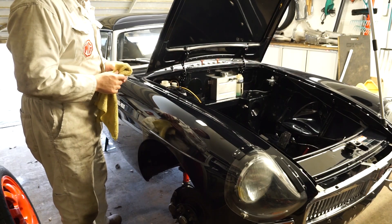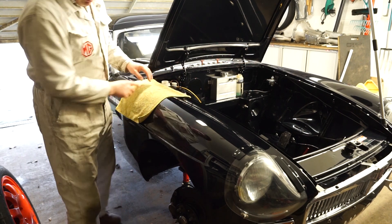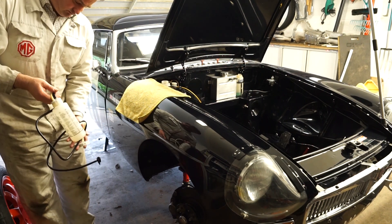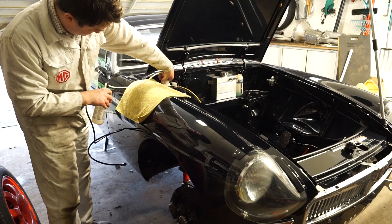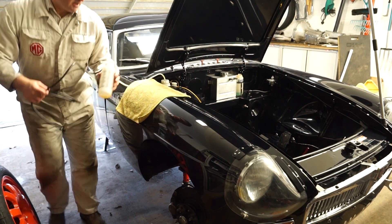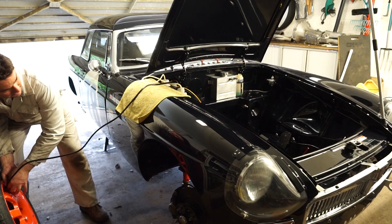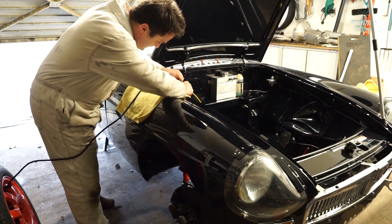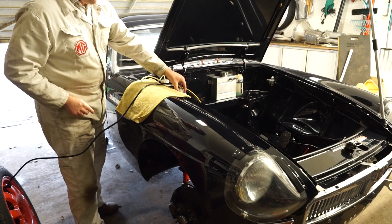I'm a little tight on space in this corner of the garage. I've got a clean microfibre cloth that I'm going to lay over the wing so when we put the leads across from the Gunson's we won't scratch the paint. I'm going to screw the cap from the Gunson's kit onto the master cylinder, and out of shot I've got the spare tyre that I'll be connecting to. The spare tyre has been set to just under 20 psi. I'm going to clip that on — I can hear the air blow through. I've got no air coming out of the system now, which means I can fill the container with brake fluid and we'll get started.